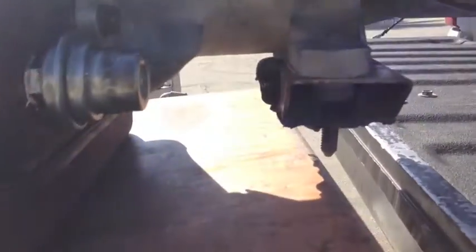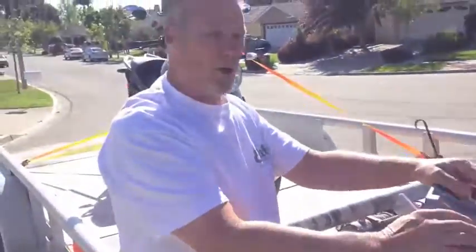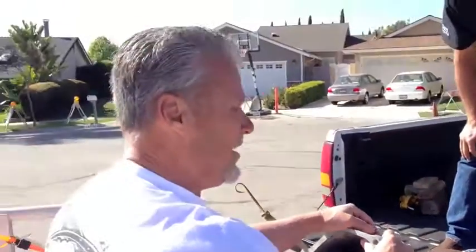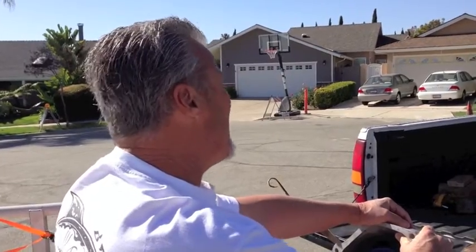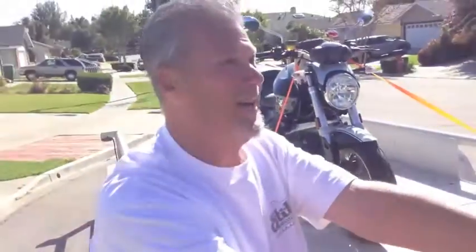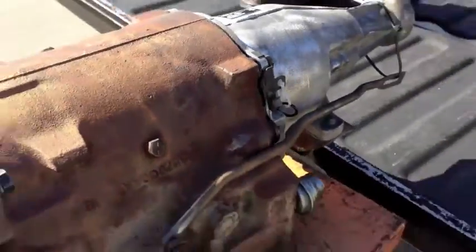On the bottom, these studs are very hard to slide around. That trans mount is shot — it needs a new one. I pulled it back on so you'd have one to match up, but obviously it needs replacing. Always put a new mount on these; they're not expensive. You can buy them at O'Reilly's — I think I paid nine dollars for the early Mustang ones. Guys on eBay think they're gold and sell them for twenty-five.